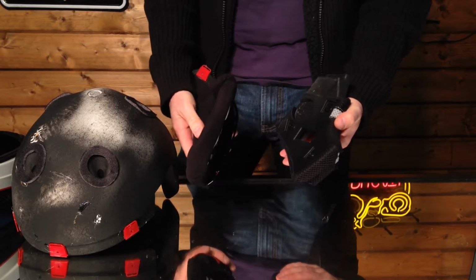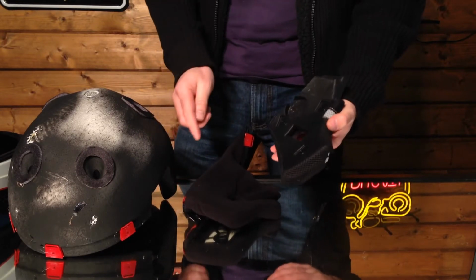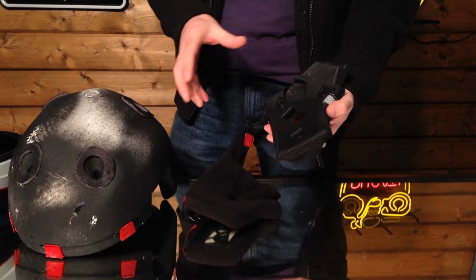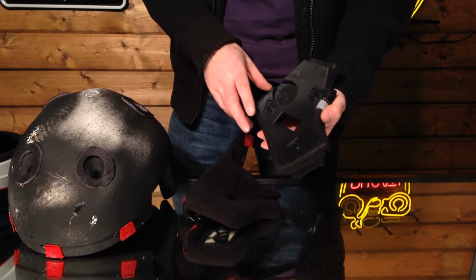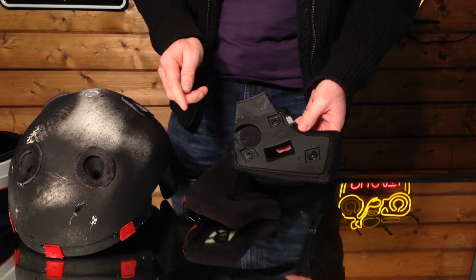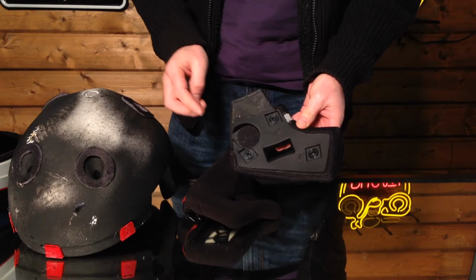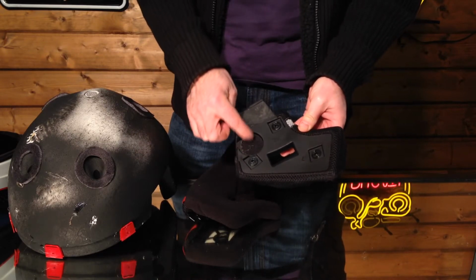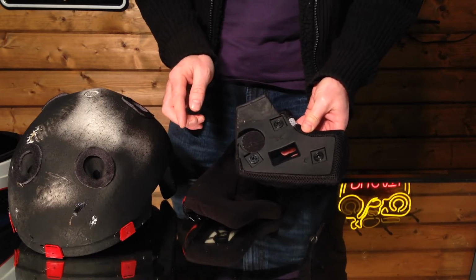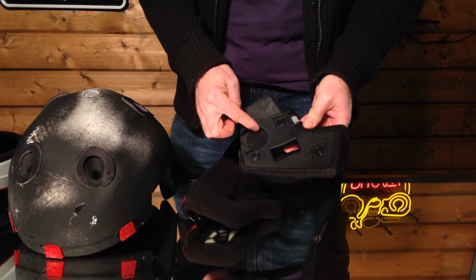So by pulling the helmet apart, it allows me to demonstrate exactly how to put the emergency cheek pads back into place once you've put your intercom wires and the like fed through the helmet, and also lets me better show you exactly how to house your intercom speakers. This is the area where your intercom speakers go, one either side of the helmet. This diameter here is 40mm, so if you're wondering whether your intercom will be accommodated into this helmet, measure your speakers and they will need to be 40mm or less.